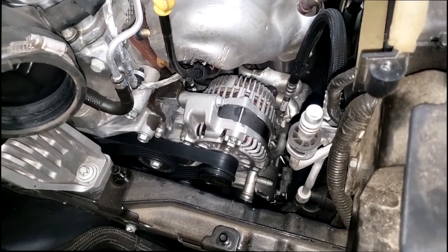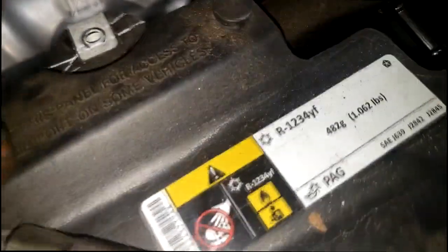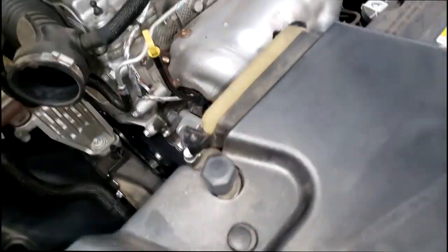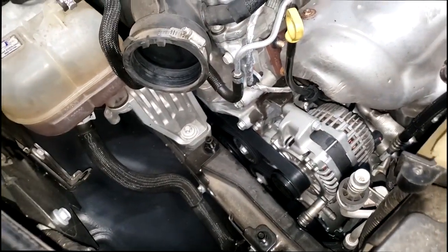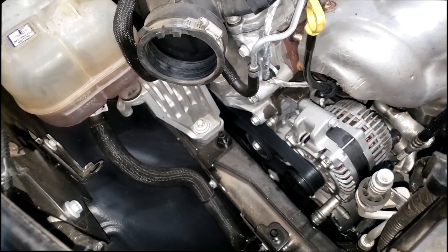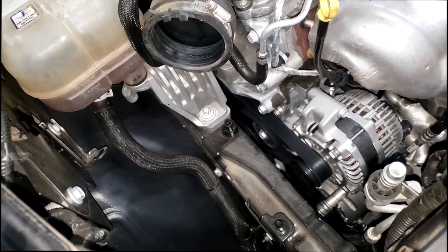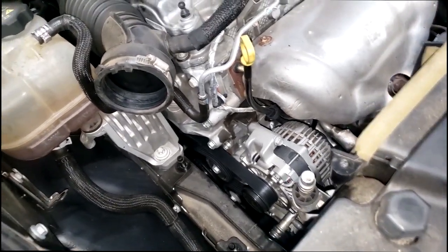You would think that makes it easier to find. Remember, this freon is R1234yf, which from what I'm told has dye built into it. So if your gauges register zero, you obviously have a leak — unless somebody physically took it out using a machine, which is highly unlikely.